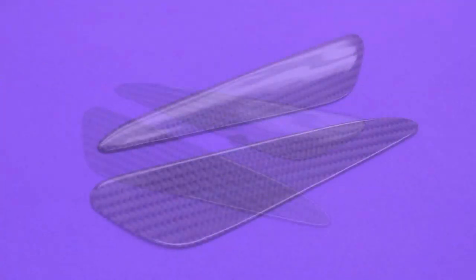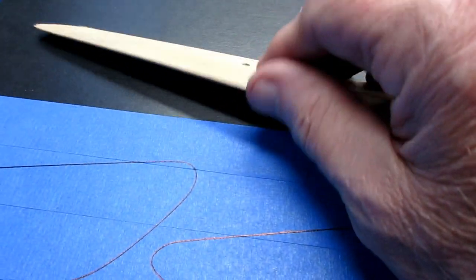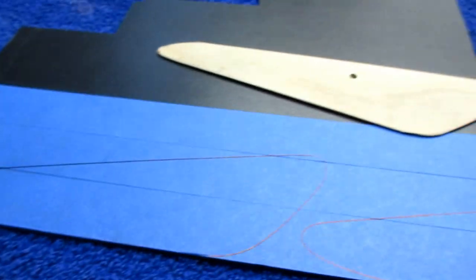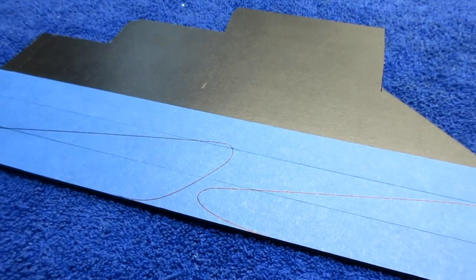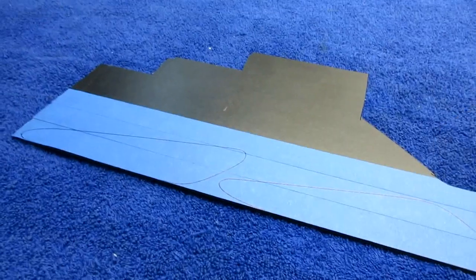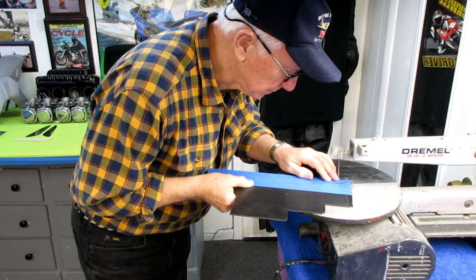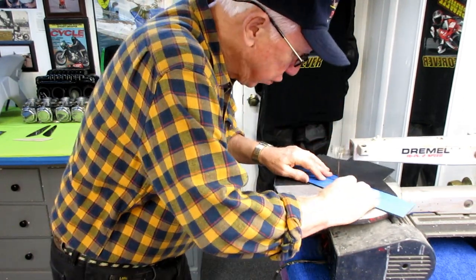This material, as long as you don't have a fisheye issue, usually buffs up so easy you could do it by hand. The only issue I've ever run into is when you wind up having fisheyes. I may have enough time here - this is the template I traced out. There's no grain in this so I'm just looking to cut pieces out. I'll get the jigsaw, cut these out, and do a final fit. This is just solid carbon fiber - I'm going to prime these, get them nice and smooth, radius all the edges off, and then paint them the blue that matches the tank. I'll have two sets: a blue set and a carbon fiber set. Use slow speed, and buy an extra box of blades - this stuff is really rough on blades.